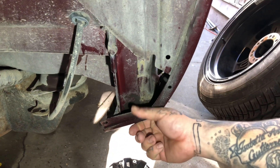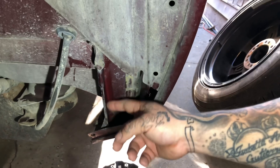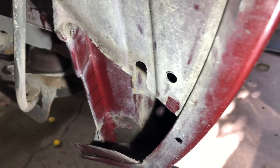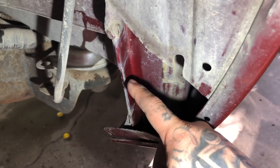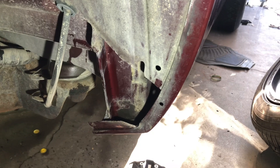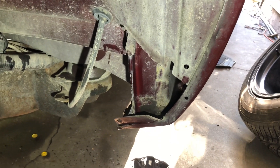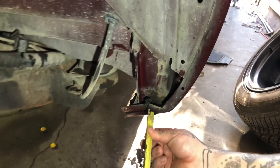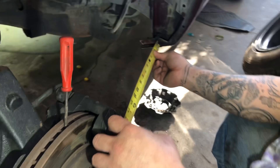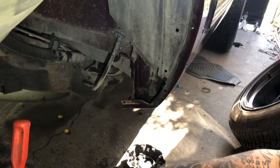Pretty much what you're going to want to do is take this lip right here and bend it straight — get some pliers and just bend it down straight — because you want to get into this seam right there. I kind of marked it with a Sharpie. You're going to cut with the grinder straight in, that way it's a lot easier to bend when you're hammering it back. But first I want to measure before and after — roughly 14 inches from that lip of the fender to the brake caliper.